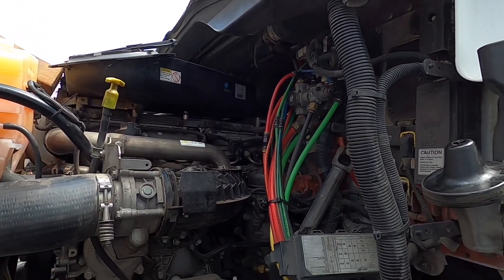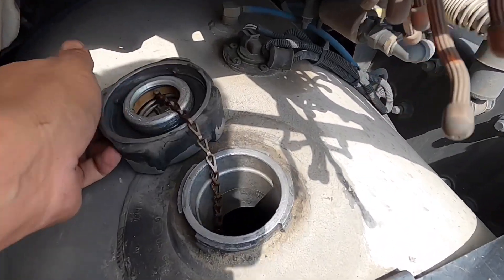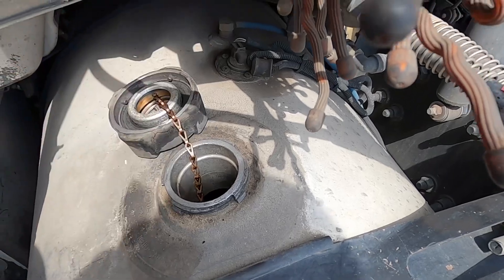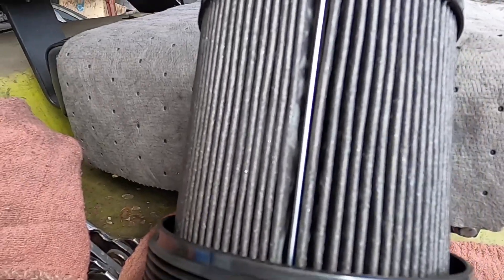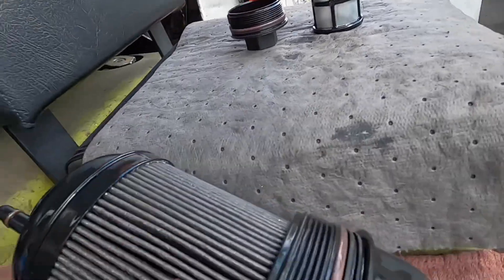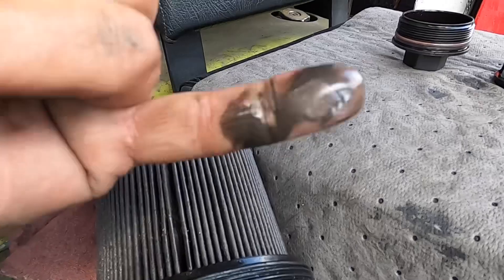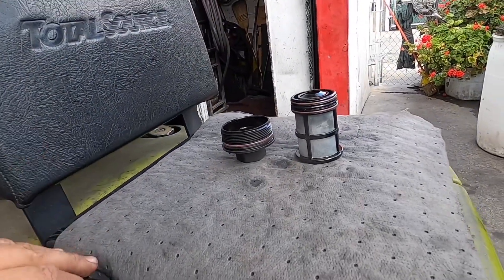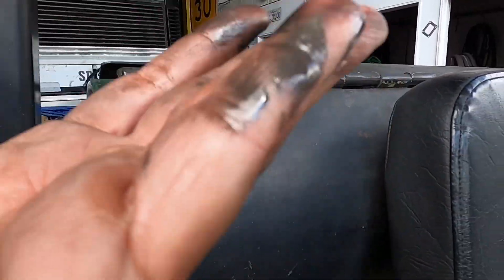We're going to tear it apart so we can get it back together for this customer as soon as we can. Also, if you remove the cover and grab a flashlight and look all the way down inside — look at your diesel fuel. If you see it's really shiny, that's another telltale sign. Here's the other fuel filter — this one's definitely going to have some metal in it. I'm going to slide my finger in between and you're going to see some of the metal debris. There you go — you see that shimmer? That's all fuel pump right there.